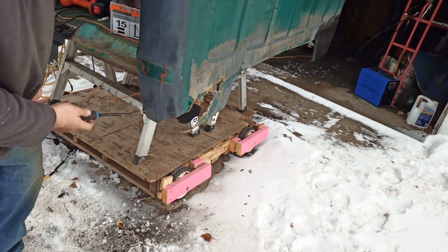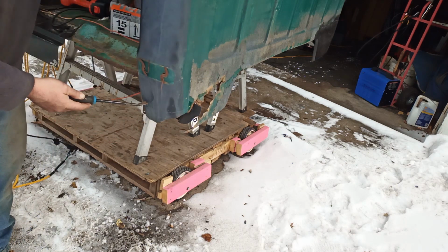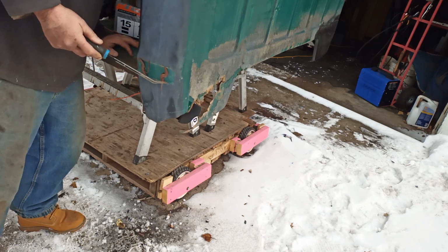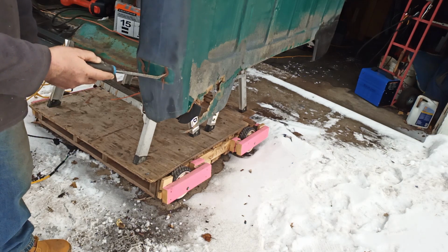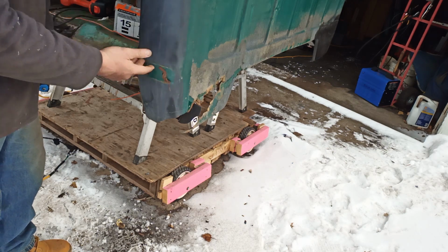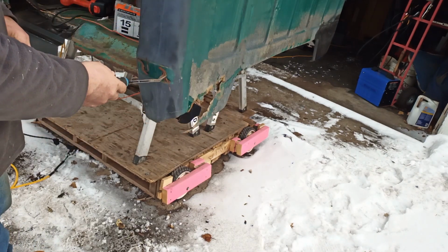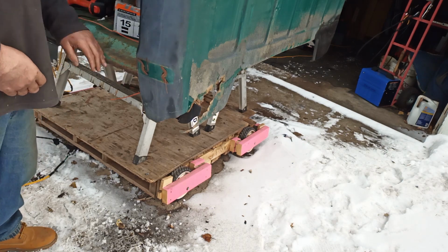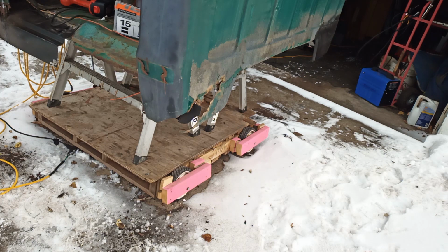So I'm only going to take out what is rotten. I'm probably going to come in and just cut out into here. And before I came up way up here, yeah. So I'm not keeping the trim on the truck, I'm taking it out. So I thought, well, it'd be easier to just cut this out, put it all in, fit nicey nice. Does not fit. So I think it'd be a lot easier just to plug weld, patch those holes, and bond them than trying to fit that whole thing. So we'll see. I'll let you know.